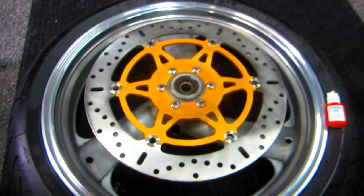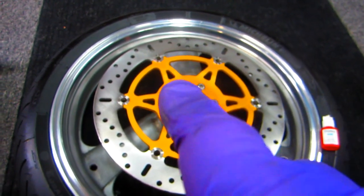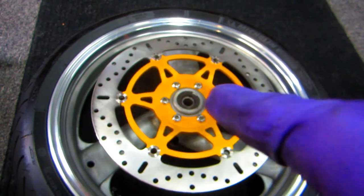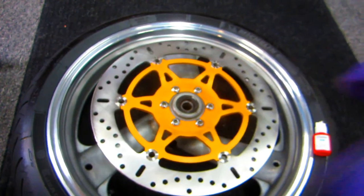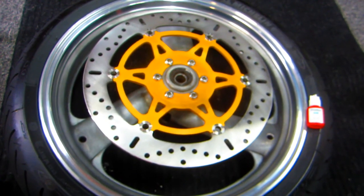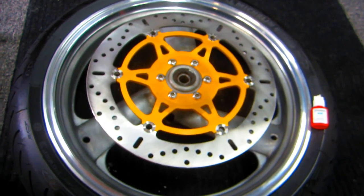Blue Loctite on the bolts, and what I like to do is just the way you would torque the head on an engine, star pattern, opposite. Torque each one down hand tight, and then about 5 or 10 pounds more, same thing in the star pattern, and then put the final torque on with a very accurate torque wrench, and it's not even a Harbor Freight torque wrench. We have a good one. We paid list price for one. It's unbelievable.